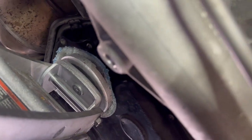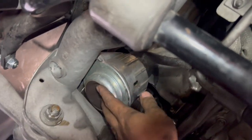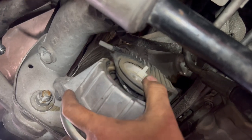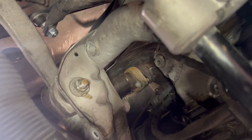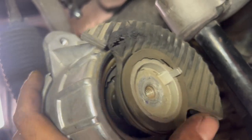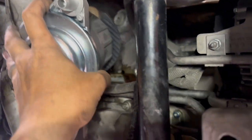We have the engine supported with a soft mat, just enough to pop this off. This is the passenger side mount — very loose and brittle, definitely needs to be changed. This side is a little easier, though the cat is slightly closer to the top nut, making it harder to reach, and the coolant reservoir tank up top makes it hard for a friend to help. Putting the new mount in now.